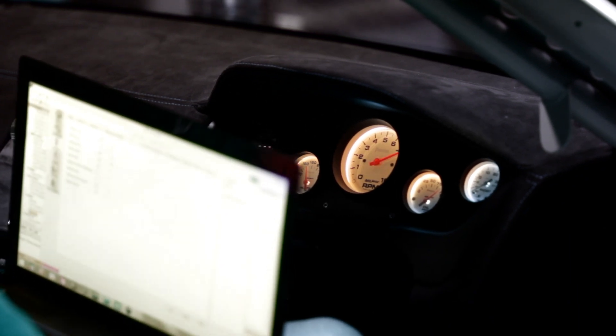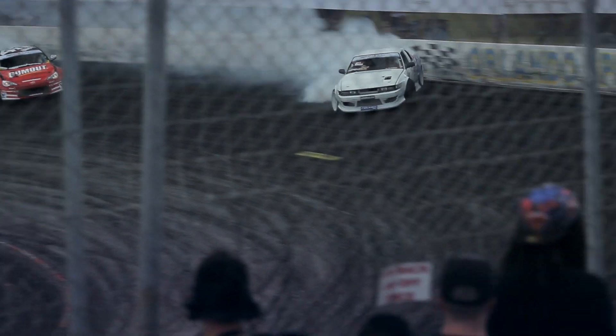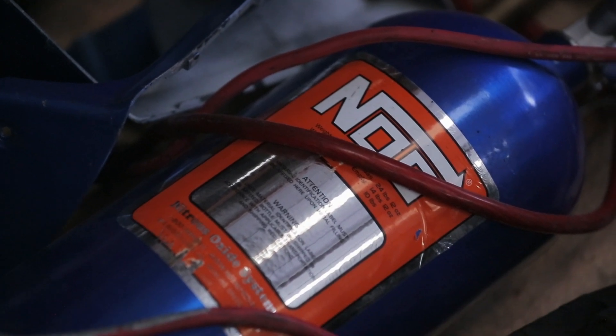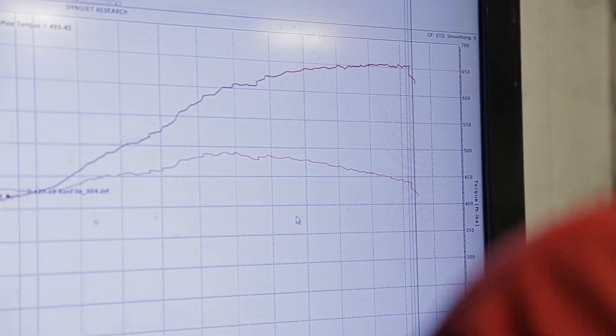The car spins out to about 8200 RPM, and because the RB doesn't make as much torque as the other competitors' engines — the larger displacement 2Js or the V8 cars in FD — I've got to keep the RPMs up a lot higher to stay in my power band. The nitrous obviously helps to keep the turbo in spool and keep it going. I was nervous about it at first, but once we saw the numbers on the dyno and the power graph, I was stoked on it.